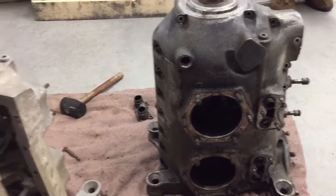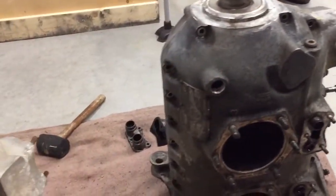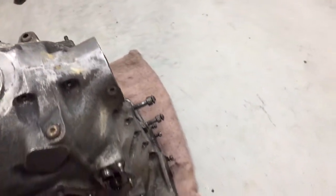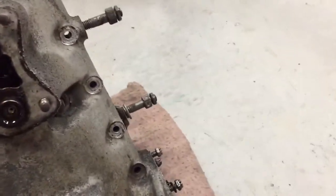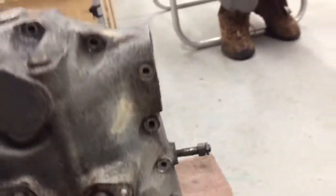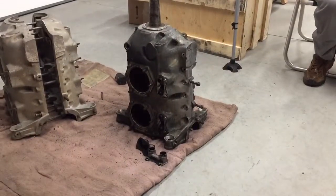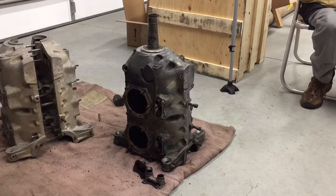What we do is take a rubber hammer and tap on these two studs, and it should separate the crankcase. But first off, you want to make sure you get all of your bolts and nuts off. There's a couple hiding out — there's one right down here on the bottom, right there in the center of the screen, and there's another one right up in here. We'll try to pull this bad boy apart, and hopefully it'll help somebody. A friend told me to tap on the cylinder studs.